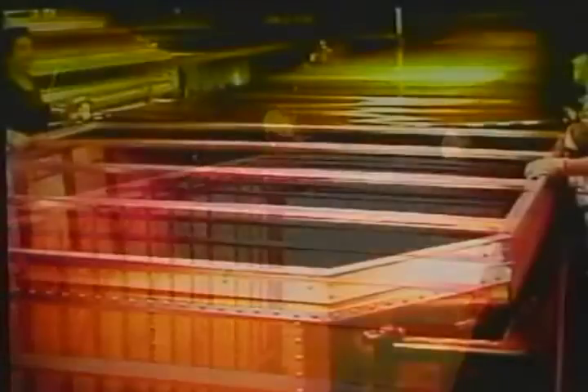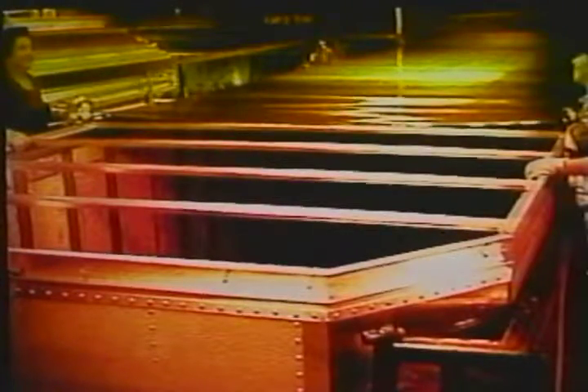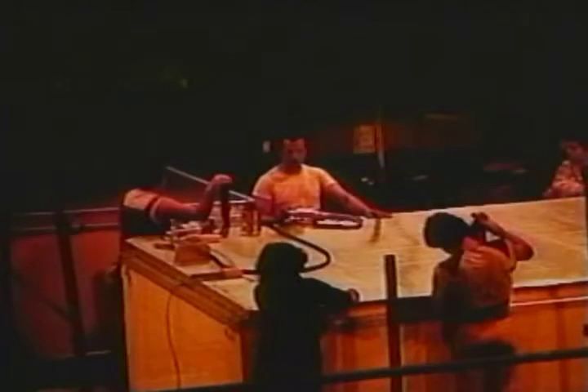First, roof bows generally fabricated from aluminum I-beams are installed at 24-inch centers and are attached with TIP-specified buck rivets to the top rails of each side. On a TIP trailer, the roof itself is made of .040-inch aluminum sheeting, 25% stronger than the .032-inch sheeting specified by much of the trailer industry. This sheeting is pulled forward and firmly attached to the nose section wall with rivets spaced two inches apart. Special tools are used to stretch the aluminum roof tightly across the bows to provide a solid connection between the side walls, nose section, and rear assembly. This connection, which allows stresses to move evenly among component parts, is a key feature of semi-monocoque construction.